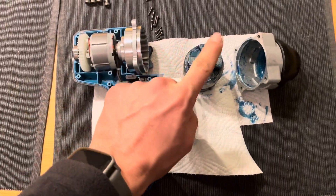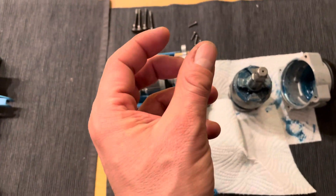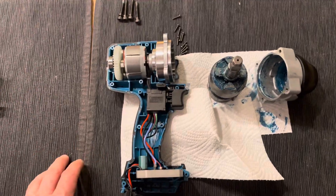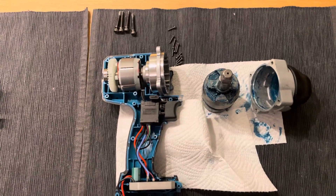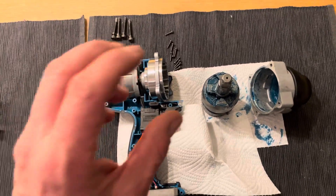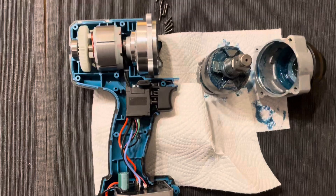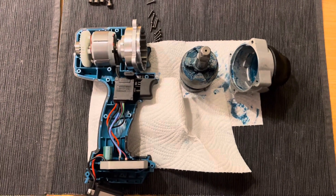What's very important is that you use an impact socket — a socket that has no clearance and sits tight on the bolt. If they wiggle, the impact driver is not able to loosen the bolts. Don't use a socket from a normal wrench set, which has rounded corners and edges that could wiggle on the bolt and prevent full torque. I hope everyone could see the technique in this machine — thanks for watching, see ya.